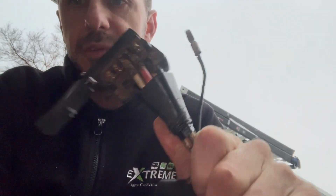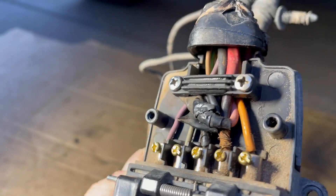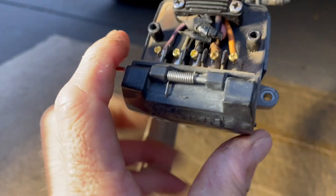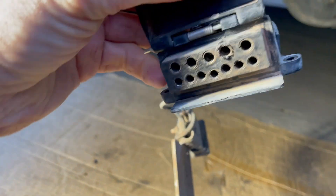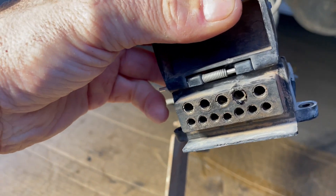See what Jayco do — the D+ wire is tapped into the main feed. Vehicle pins nine and ten need to be isolated, because when the isolator turns on and off it'll shut the fridge down and that 15-minute timer will start on your three-way automatic fridge. Now look at this horrible job on the vehicle end. I'm not going to name names — we're here to fix it. That's just twin-core six-mil cable for a 25-plus amp load over some 12 meters. This is the result — this is always going to happen trying to flow high current through those pins.